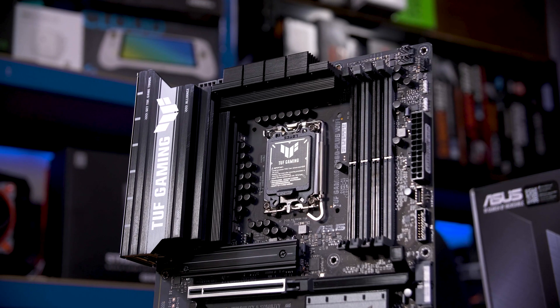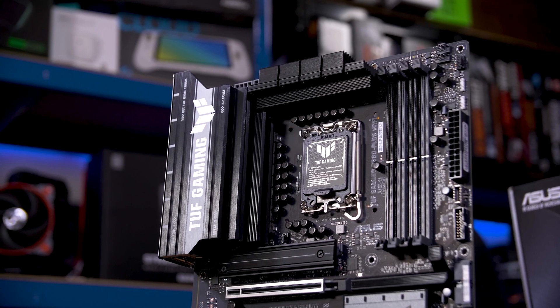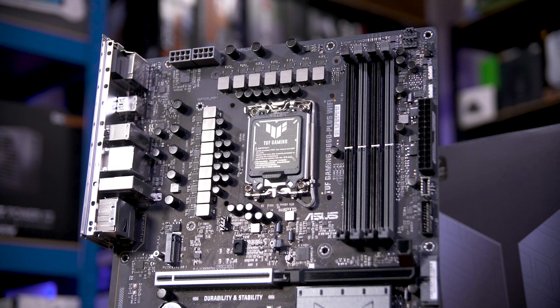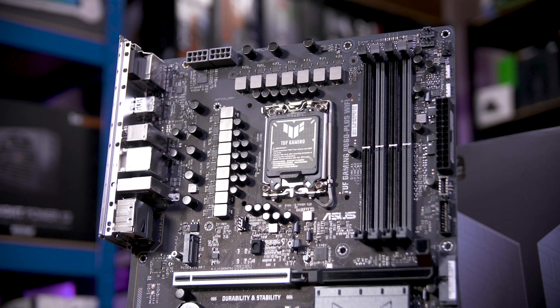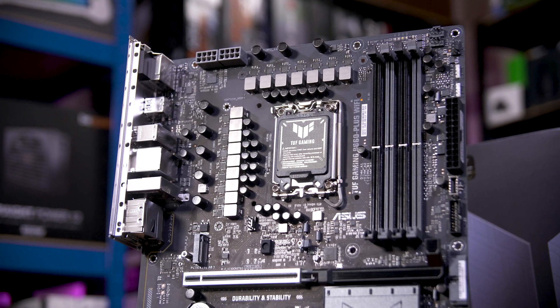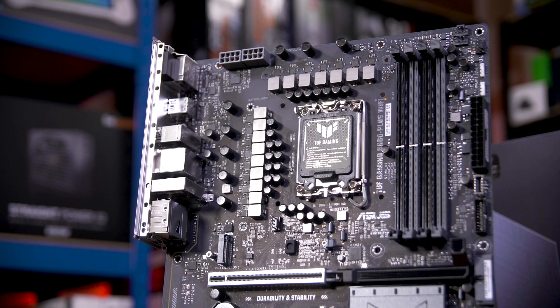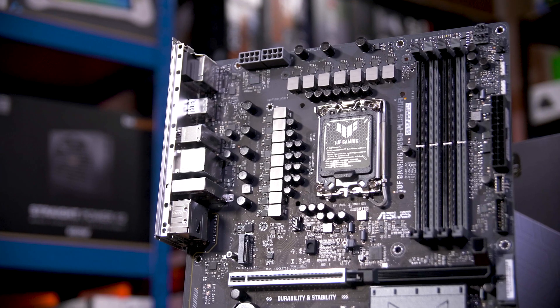This Tough board, which is meant to be ASUS's more mid to low-end range, has 16 total VRM phases, which is just insane, especially on a board that really can't overclock. It has two 8-pin EPS CPU power connectors, each of which is generally happy to run a little over 300 watts. The 285K tops out at 250 watts of boost power. You'd have to be pushing the very top-end chip considerably harder to exceed the need for one 8-pin. So yeah, this VRM setup is overkill, and most B860 boards are kind of similar. The VRMs are not a problem here.